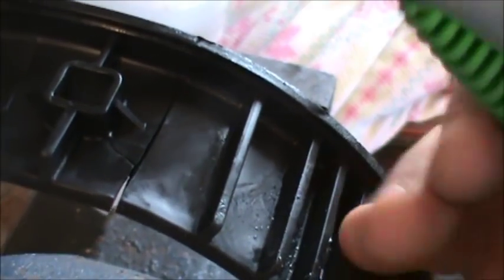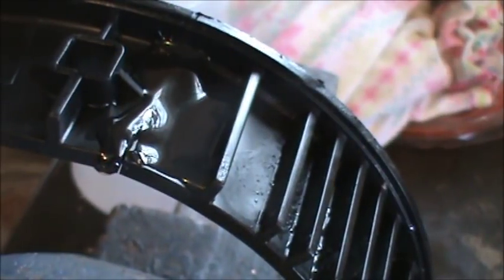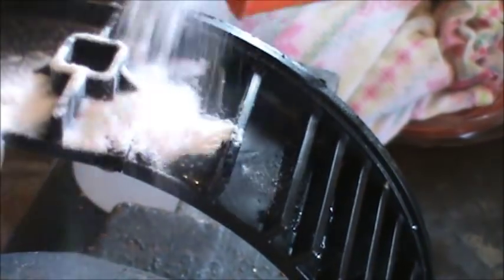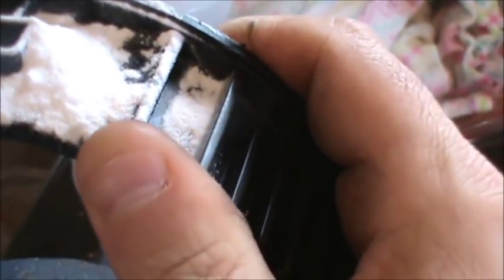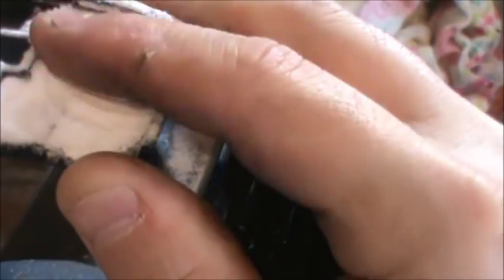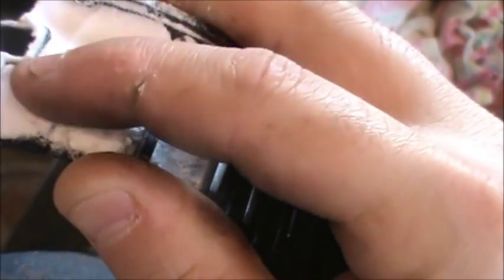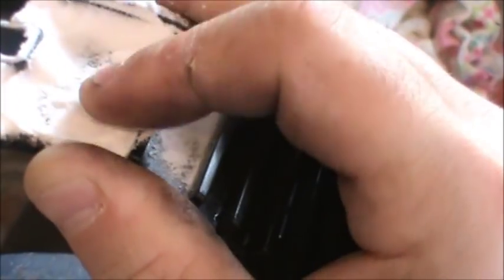It's like concrete. So here I have a pretty good crack and what I want to do is build up plastic on top of this whole area, squeeze that gap together so it doesn't leak through. To do this I'm using super glue and baking soda. We're going to take our super glue and put a fair amount right on here, then take our baking soda and put it right on there. I'm working it together — this is going to get like concrete. It has some sort of exothermic reaction where it creates a lot of heat. I can feel it getting hot on my finger.